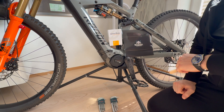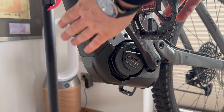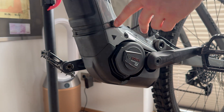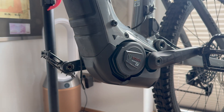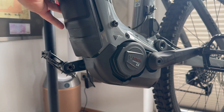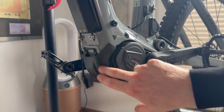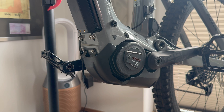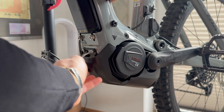Let's get started. I will mount the bike in the stand. Once the bike is mounted, we first remove the front cover. Move the pedal out of the way if necessary. Open the rubber strip and loosen the top screw if needed — in this case it wasn't really necessary. Carefully lift the cover off and put it aside. Next is the lower protection cover, which has two screws at the front that we need to loosen with a four millimeter Allen key.